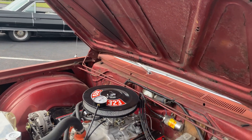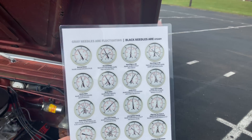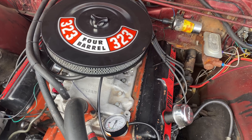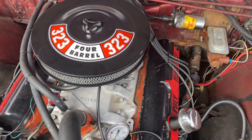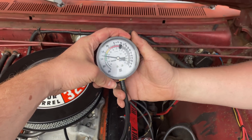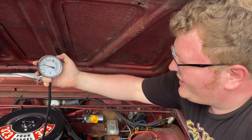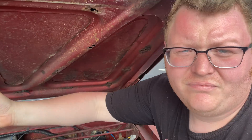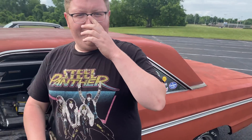Let's start this one up - hold this up so you can take a screenshot if we can get it to focus. So you can see this is 18 inches of mercury, very steady, no problems at all. Older cars sometimes came with a vacuum gauge but called it something else to sell more cars - like a 'performance indicator' or 'fuel saver.' All you need to know is it was just a vacuum gauge, and I installed one on this car.